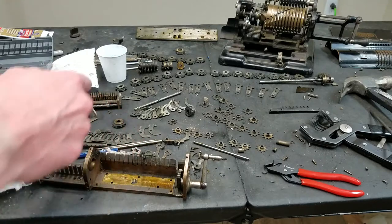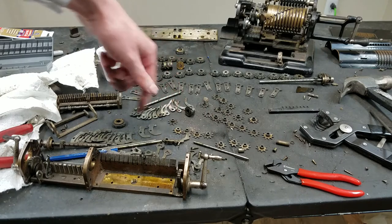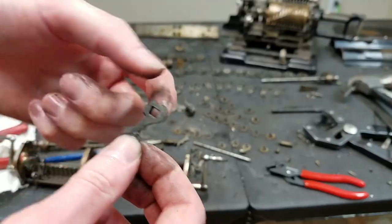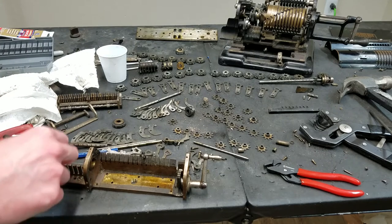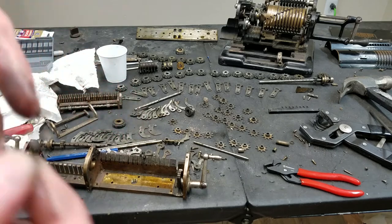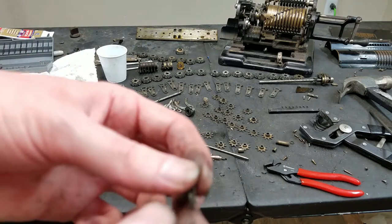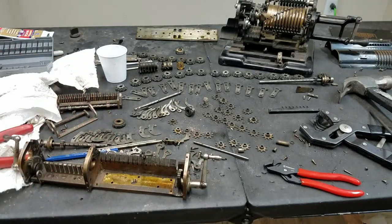On the shaft that runs through here, the ones here on the front are the intermediate gears for the carry, and the same shaft that holds those also runs through these square portions here, so that they can lock on that. And of course these are the springs for the counter detents. This front piece hooks on this shaft. And then this back piece hooks on the bottom of the detent to spring load it up into the digit wheel.